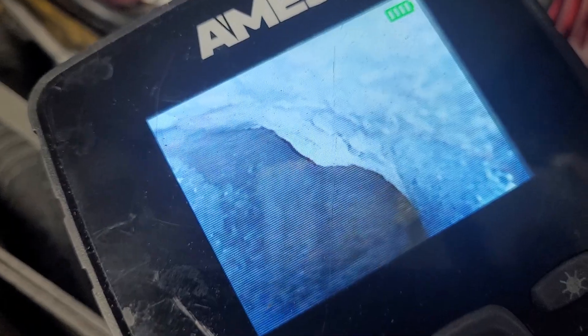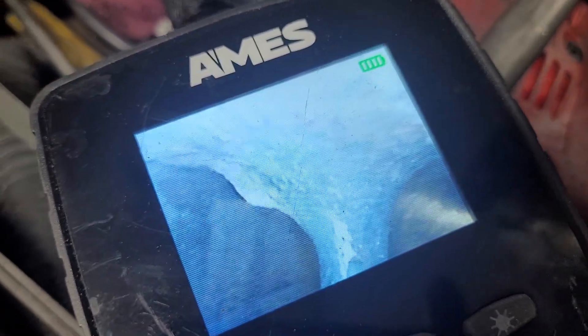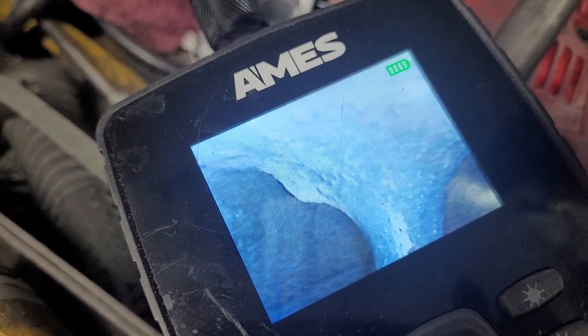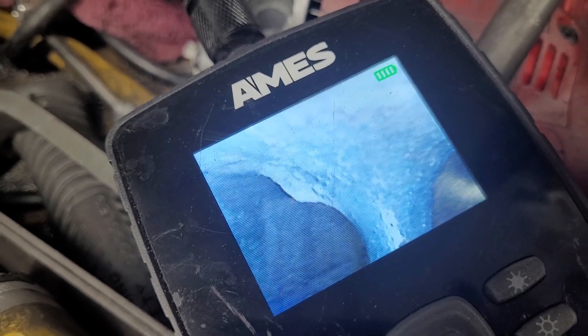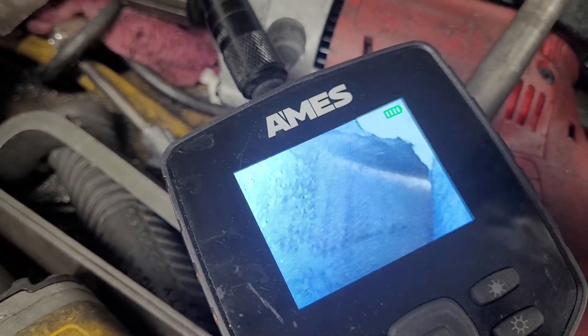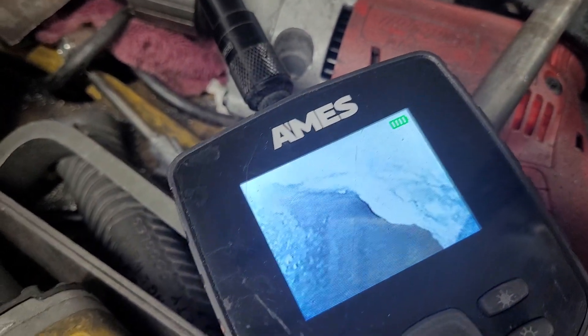There is a chunk of iron in the roof of that port. The roof of that port should be relatively straight the way I'm holding the camera right now. And we can back out and you can hopefully see the divider right there — it sticks down quite a bit, and that's after I've been working on that for quite a while before I pulled out the borescope.